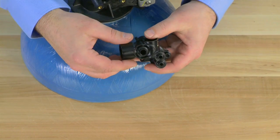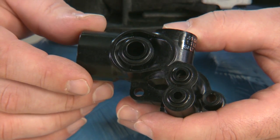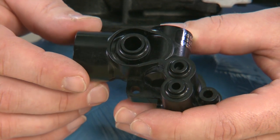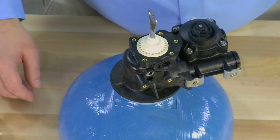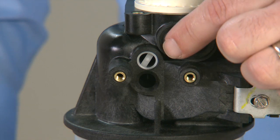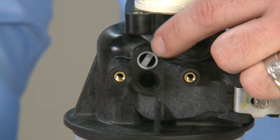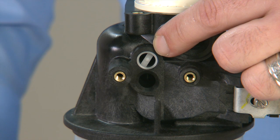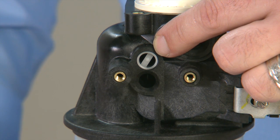On the backside of the injector assembly, there are three O-rings that seal it to the body. Make sure to check these and re-lubricate during assembly. We then move over to the body. In the openings where the injector is, there is a lower and an upper. The upper should have the white flow disperser, which is opposite where the injector assembly is.